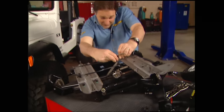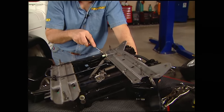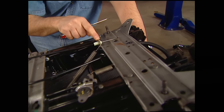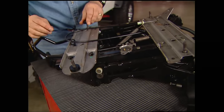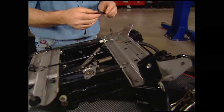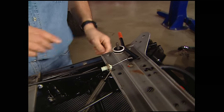Since we definitely want our passenger-side seat to still tip forward so people can get in the back, you're going to want to relocate this cable from where it was originally over to this side — it just presses into this existing tab. Then install the studs that come with the kit, slide on some spacers, you've got a seat belt adapter and then this little arm. Grease it up here in the center, hook the cable to that, put it on, and now you're ready for your seat.